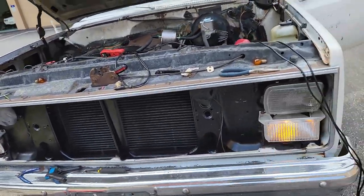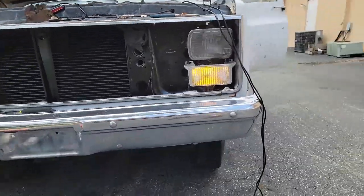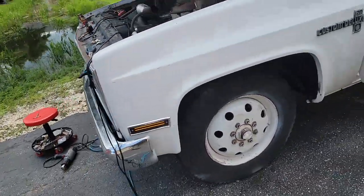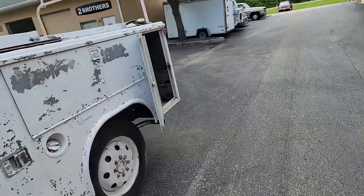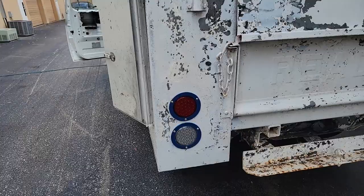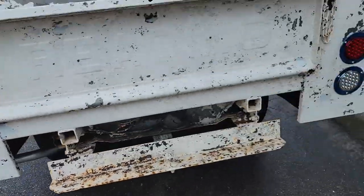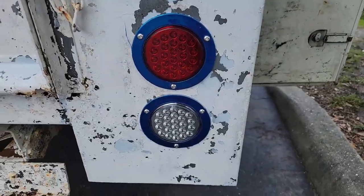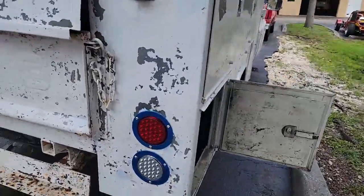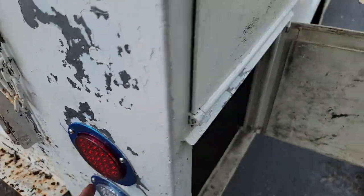Painted all this rusty crusty stuff so it'll be nice behind the grill. There's another one, straight on there. Still got to wire these up — it's going to rain so it might be a bit. Converted to those. I'll take the plastic off after I'm done painting. Quarter-twenty, drilled and tapped, put stainless in there — and that's a stainless ring. At least the wiring's easy to get at. We'll get that taken care of later. Not driving it yet anyway.